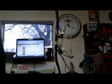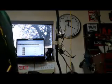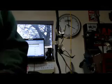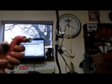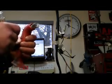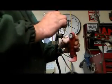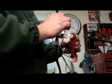Guys, Saturday morning, I'm still doing my wiring loom. I'm just soldering, I'm doing an alternator conversion from a dynamo. I'm just joining the wires that aren't required from the original control box. Just twisting them together and then soldering them.